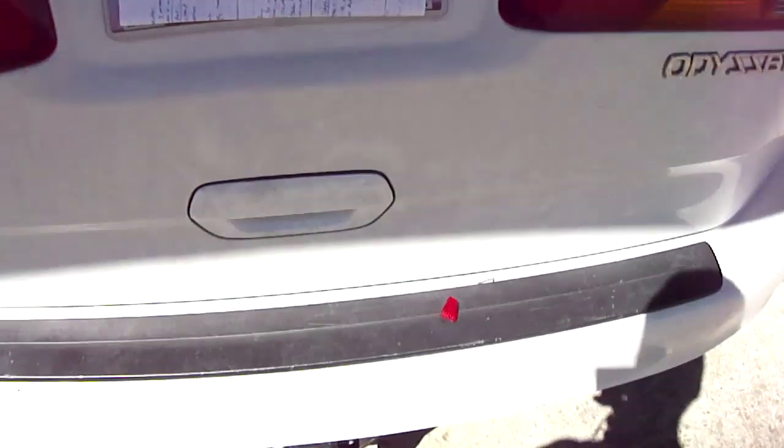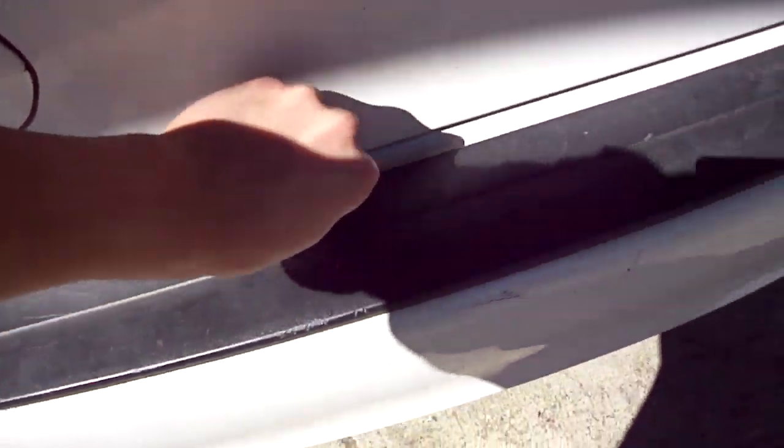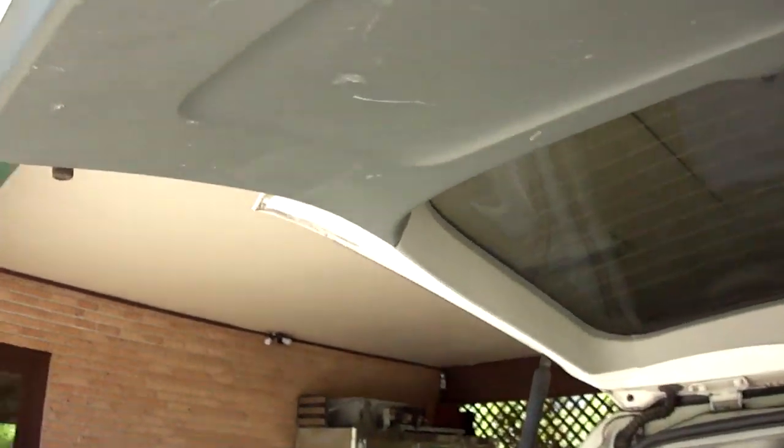Put the screw back on there. All right, and now for these bulbs. It's really, really simple. I'll put this on the floor first. All right, open the trunk. This would probably be easier if you have it half closed or inside the trunk, and have the trunk holding itself. Once again, get your flathead screwdriver and pop it like that. And then there are two bulbs right here.